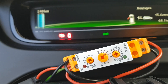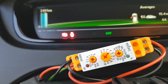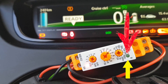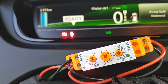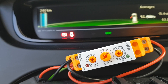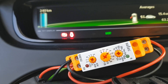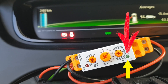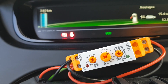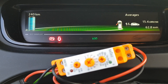Now with the switch in place, as soon as I turn on the car — press the brake and press the start button — the red LED lights up, meaning the power is on. Then the green LED turns on for almost one second and then turns off again. I'll show you once more: the red light turns on, meaning the car power is on, and then after about one second the green light turns on also for one second and then turns off. This green light pulse is the impulse to the switch — it emulates pressing the button to turn off the sound generator.